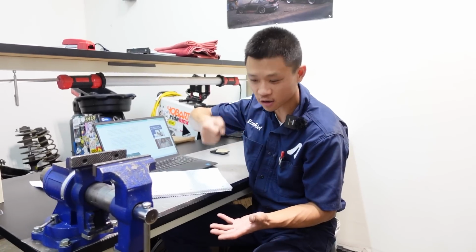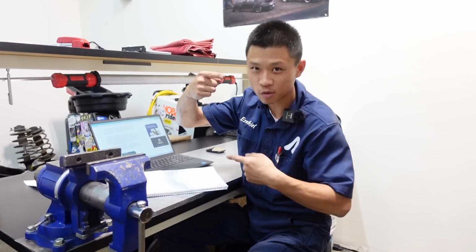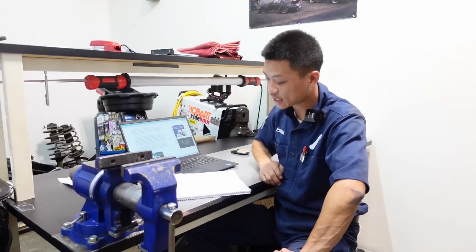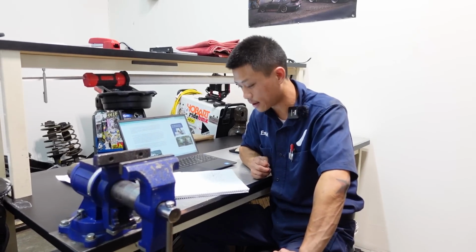Excessive silicone, remember I talked about looking like bacon earlier? So yeah, I'd see timing covers where the robot put enough of that dark gray silicone that when it sealed together, you'd see like two strips of bacon on both sides of that timing cover. And I remember in my mind, like, oh, well, they tried to do a fix, but they still leaked sometimes. In my opinion, an excessive amount of silicone in some areas and still had a problem leaking. Here we are many years later, no longer a dealer tech, and I think we're still fighting the same issues.